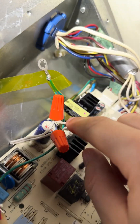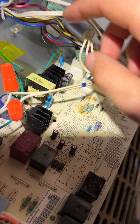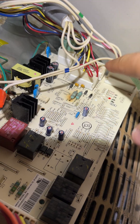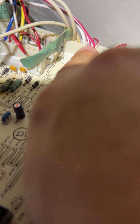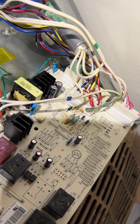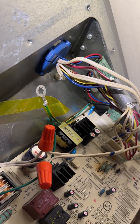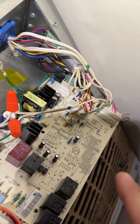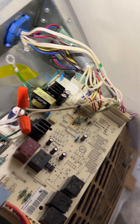But on this side, while this was still attached here, between the two wires going to the terminals, it was reading about 16 and something, and nothing was changing. So somehow this wire inside the cabinet had failed and was not giving the correct value to the control board. I also tried a different control board before, and that didn't change anything.